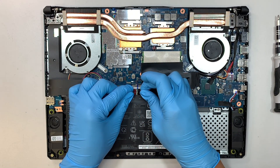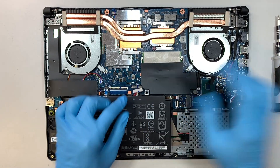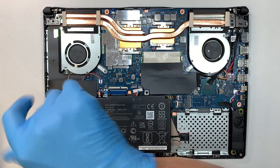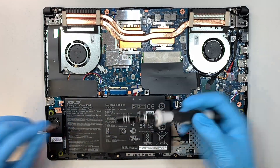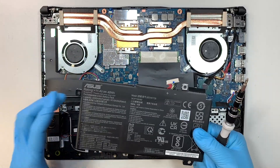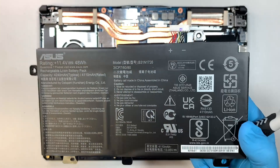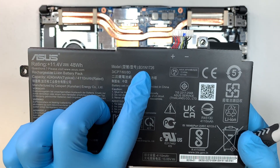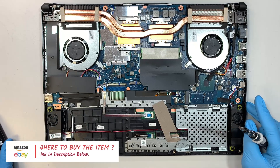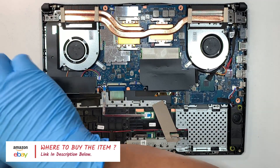The original computer comes with just one hard drive and one RAM. Let's go ahead and disconnect the battery — you just have to slide the connector down. There are two screws holding down the battery, left and right, and then the entire battery will just come right off. If you're not sure where to buy the battery, look up the model here: B3-1N1726. I'll link it down in the description below and direct you to either Amazon or eBay for the battery replacement.